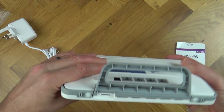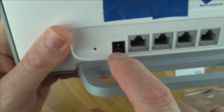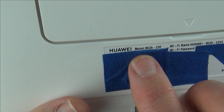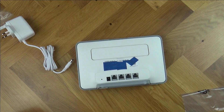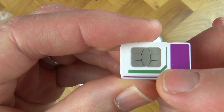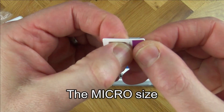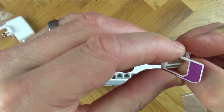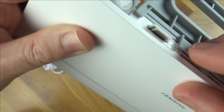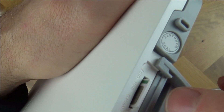Let's get the SIM card and pop it in. The slot for the SIM card is just down here and they've taken away one of the corners so you know the exact way to put the SIM card in. On the back we've got our power supply input, four LAN ports, and the last LAN port is also labelled as WAN. We've got three different sizes on the SIM card: the mini size which is the biggest, the micro which is the medium, and the nano which is the small one. This router takes the middle micro size. Looking closely, the corner is cut off, so you push it inwards and slot it until it clicks into place — it's a little bit fiddly but you can hear it clicking. To take it out, you just press it.